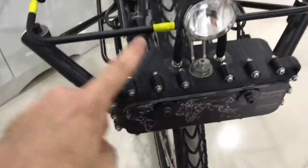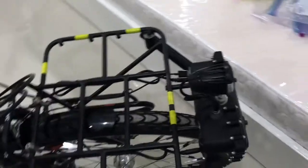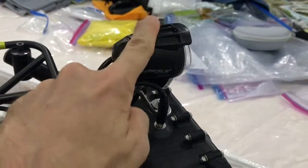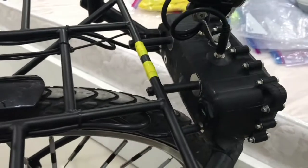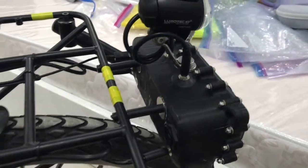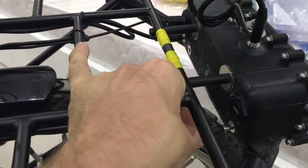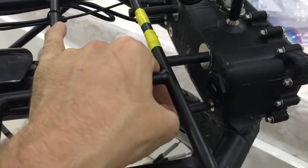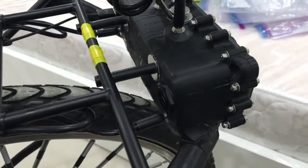Also in this is just some screw terminals and a bunch of wiring, so that all of the interconnect between the generator and the light system and the chargey stuff is all done here. The idea I was going for was that I wanted everything in the bike to be either solid objects, kind of like this, or the generator hub down there, or wires that were completely removable, so that the wires could all have spares, and I wasn't making and breaking connections between wires on the bike itself. I wanted all of the interconnections between wires to be happening in here and in here only. And I got what I wanted, so that's great.